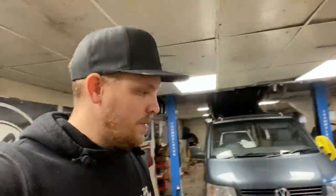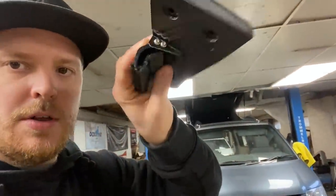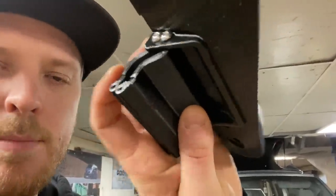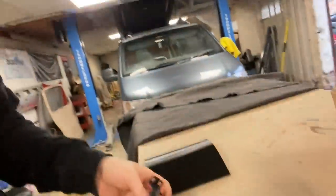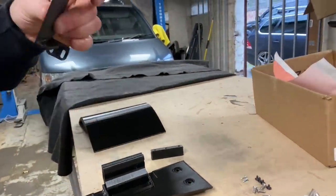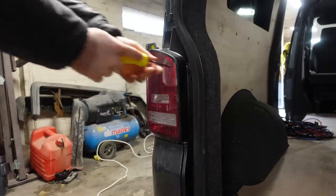When you buy the kit you get a QR code on the box which has got full detailed instructions explaining every single step. Transport HQ have also done a video explaining how to fit it. I'll do my best to explain and show what's going on as we're doing it. The first thing I've done is mount the hinges on — looking at the instructions, you've got these two little indents: those two want to be at the front, and the one with more angles goes to the inside. They fix on there with those bolts, and you use small black self-tapping screws to screw that piece on.